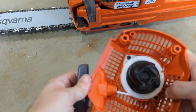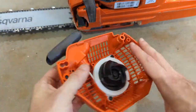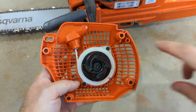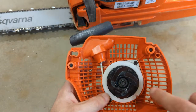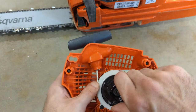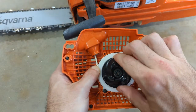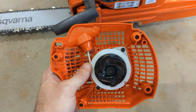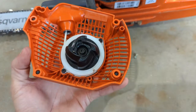Now we're all set. It's not coming off - test it a little bit - and then throw it on your chainsaw and you're good to go. You can see it nice and tight, it's not wobbling off at all, that's all tightened up, nothing coming loose here. That spring inside there is actually the one that's gonna be driving the chainsaw itself. Underneath this white piece is the other spring, and that's what we just charged up. We should be all set - the only step left is to put it on and give it a pull to test it out.